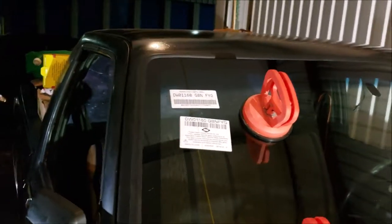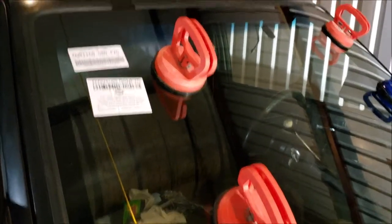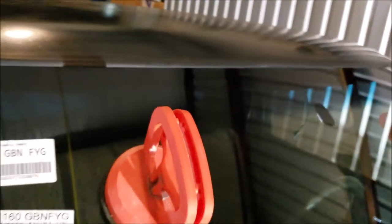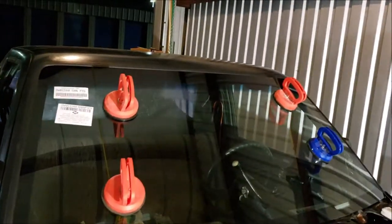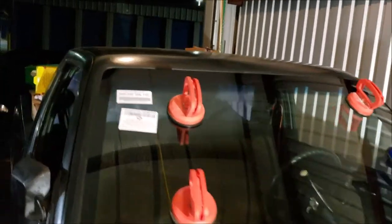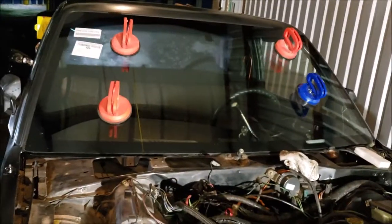Most of the guys I see on YouTube, it's a customer car, they can't stand on the hood. So they start right in the middle, and then there's a mending spot, which isn't the end of the world, but I'm just thinking to myself, that top and these corners, that's where I want my best seal personally. Gravity will take care of the rest, but if you have a pinhole up top there, gravity's going to take care of that in a bad way.